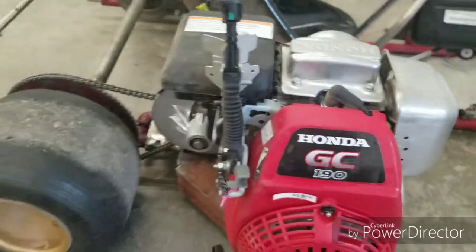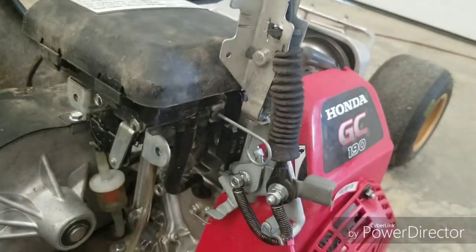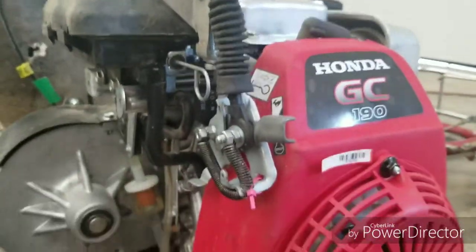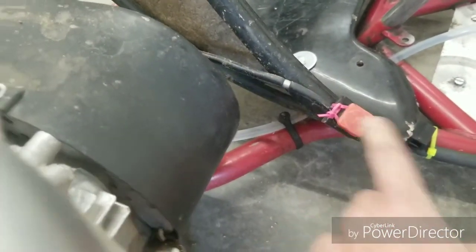The thing starts like a dream. Setting up the throttle was a bit of work — it's not the ideal system on here, so we just fabbed up a mount and some springs to help it along, but it works just fine. Kill switch — used the wire in, just a ground interrupter.